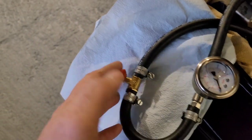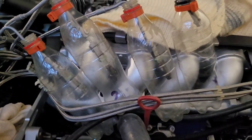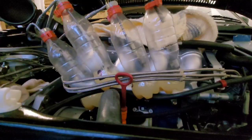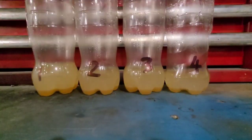The metering unit's been attacked by fuel — frustrating but it's only paint; fuel pressure is the main thing. I've also got the tap fitted now. At the moment I've got this on control pressure. Now I'm going to do our first run of 40 seconds at full throttle — the air flap is fully up. We'll run through that for 40 seconds. That's our first run done and the bottles look pretty even. I'll pull them off, put them on a table, and hopefully that's in the region of 80 millilitres of fuel per injector.